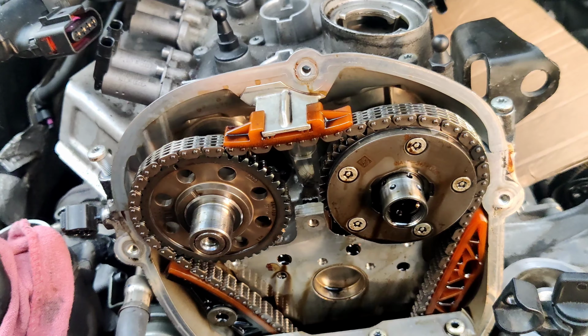As you can see, this is how it looks, and this is how the key looks. You just insert this key right there. It goes inside. Like this. And after you're using that handle, and you will start to loosen it. Now I'm going to remove this bolt, and after 1, 2, 3, 4, 5, 6 more bolts, and take this hub out.